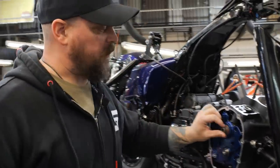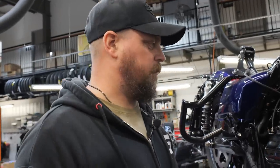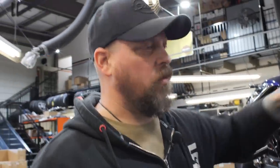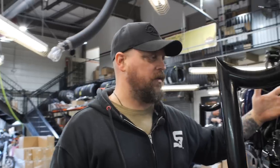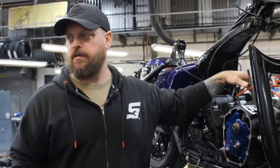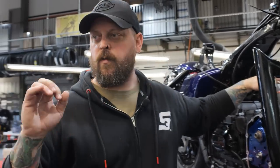So we're using a lot of his parts — his cam plate, his oil pump — because we don't need to replace them. He's already upgraded all that, which is the one nice thing. His whole primary, same existing primary, is going to go into this build. We're just changing out the cam and the lifters and that bearing, the flywheel, of course. And we're going to finish installing this, and then we will get to the cylinders and heads and go over those.